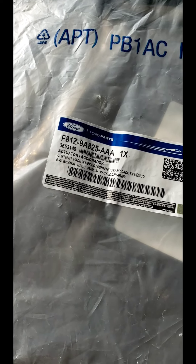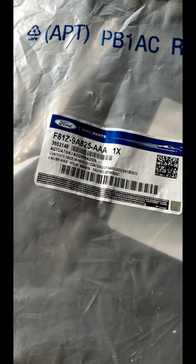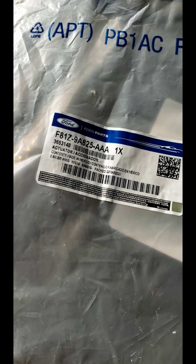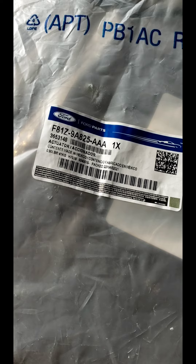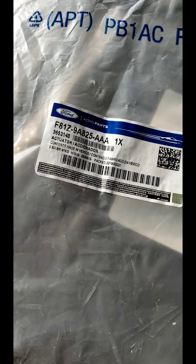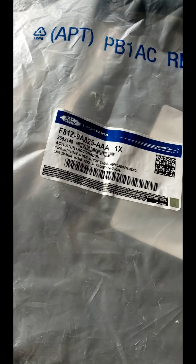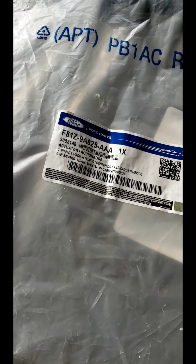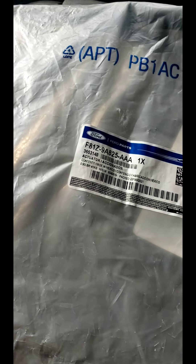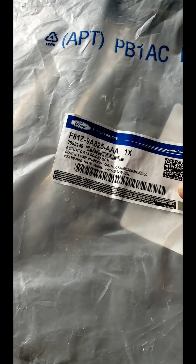I was thinking that if people are going to look for that part elsewhere, they're probably going to be looking for a cruise control cable like I was — but I was barking up the wrong tree because it's the actuator. On the Ford Parts Prime website, they show this unit as just this stumpy little cable, and if you're taking it too literally you'll say 'that's way too short.' But no — when they show that part and call it the actuator, it's going to be the whole cable.